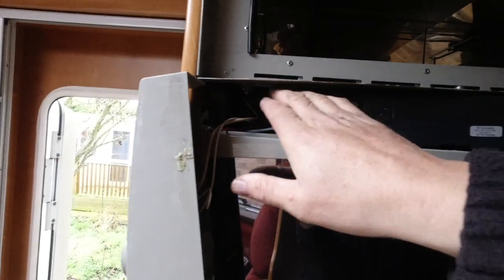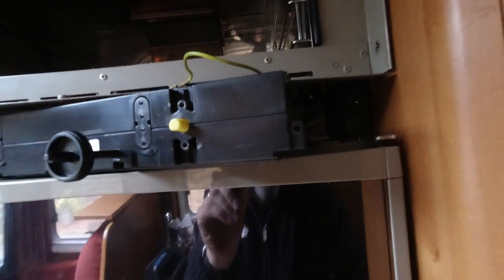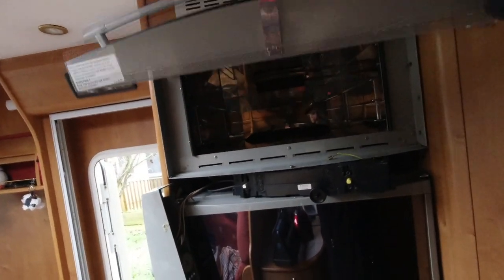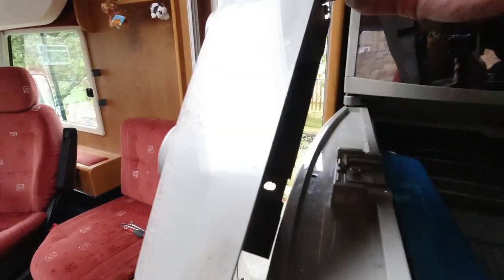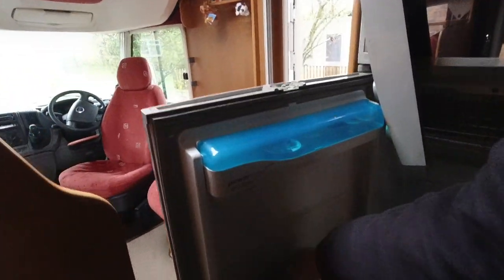I've decided there's too much going on up here for me to really understand how to remove the top without doing damage. So I'm going to remove the whole unit — what's called the Tech Tower fridge freezer oven. That's all going to come out. To finish that off, I need to open the fridge door, get that out of the way, take my pickle out, and there are screws underneath these covers that secure it to the woodwork — around four of them. Remove them and we'll slide the whole thing forward.